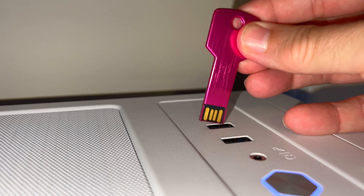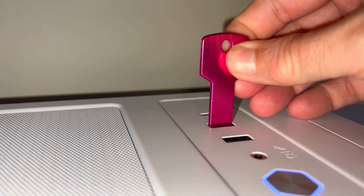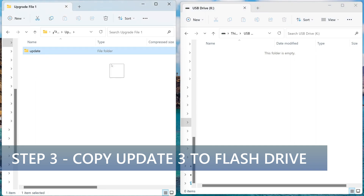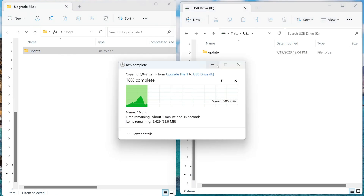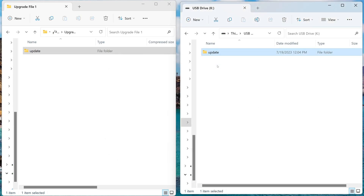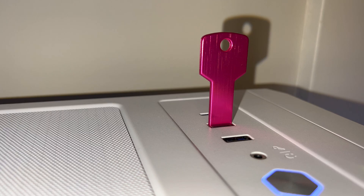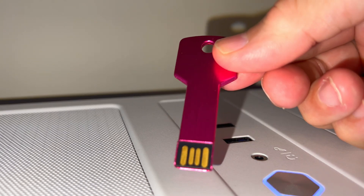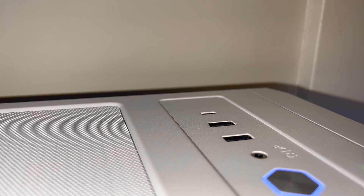Insert the last flash drive. Go back to the download directory and go to update one. Copy the entire update folder to the root of the flash drive again. This is the largest update with the most number of files, and large ones at that. Once done making a copy, do a drive eject in Windows. Take the flash drive from the PC and gather up all the flash drives and go to the Tesla.